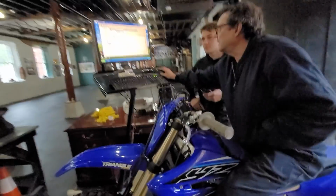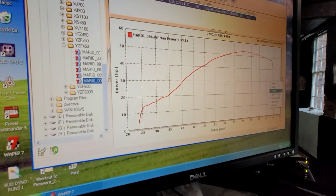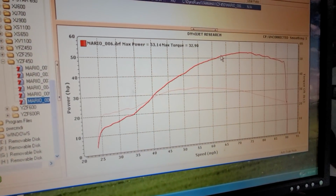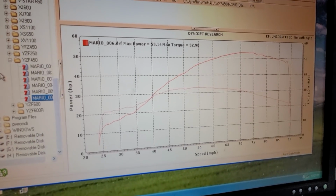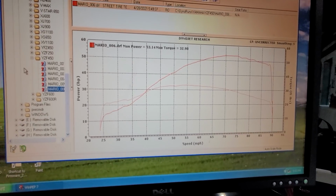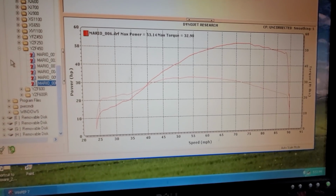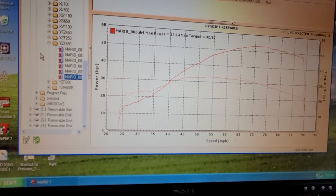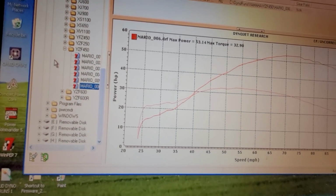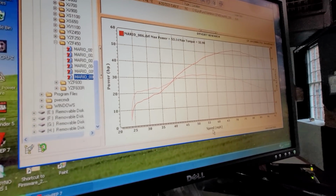Now, torque rating. Do you have a torque rating? Yeah, let's have a look at that. You got the horsepower. That's right on the money. This thing is calibrated perfectly. 32.9. Now, this is a key thing, guys. 32.9 foot-pounds of torque. Pretty wide torque curve. Can you put this directly over the CR500 map once we get that one done? Yes. Oh, that'd be sick because, Mario, check it out. Your torque curve is pretty flat across the RPM scale. Where's our RPM? Okay, let me get that show, down here.